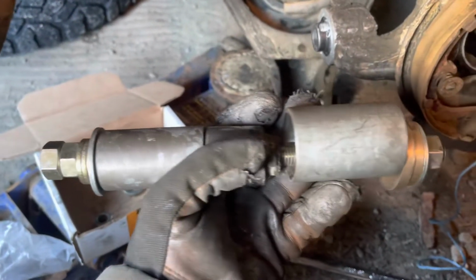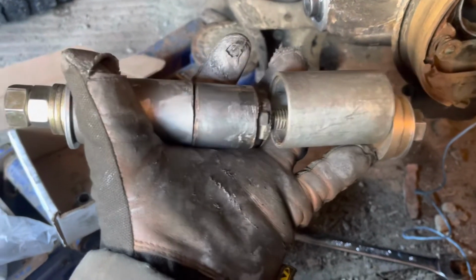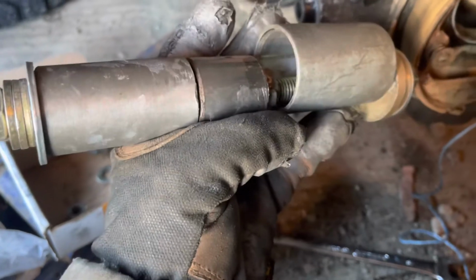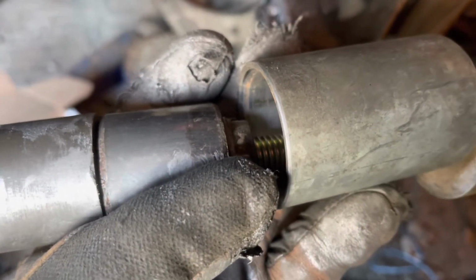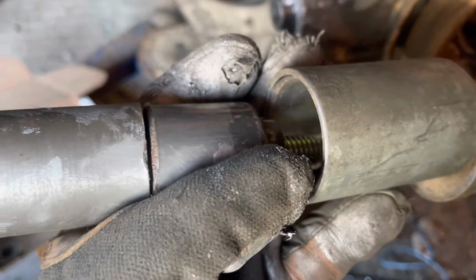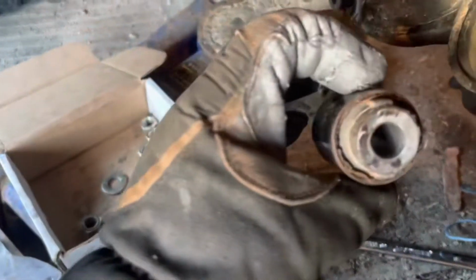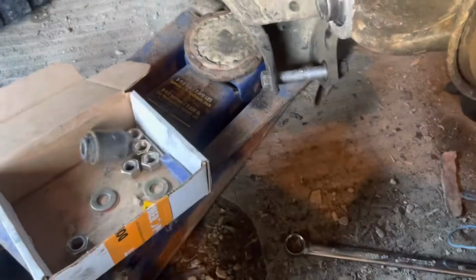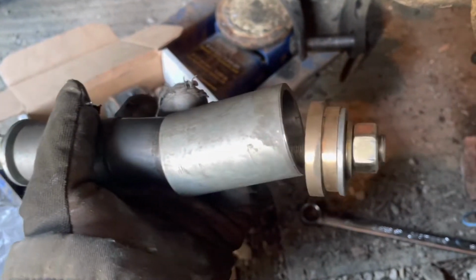Okay, one last time, this tool, just in case you were wondering what it looked like. Here it is. This is the old bushing. That's the sleeve that it's pushing into. There is a taper you can see, and that's important because when it lets go, you can kind of feel it pop and line up in that taper. This right here is machined to fit the end of the bushing and is the exact same diameter as that hole in the bushing all the way through. That's important. It keeps it lined up. And then it's just backing plates, washers, a couple nuts to make a lock, whatever.